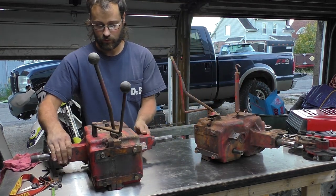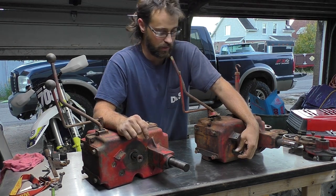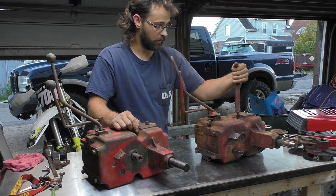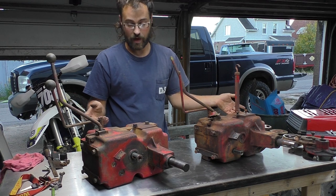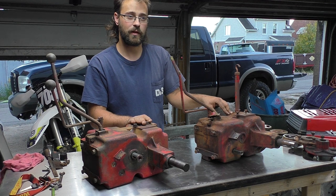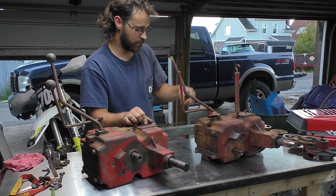The main difference between them is the brake shafts — this one is a lot larger and is keyed, and then the uni-drive has a double-D shaft that is smaller. Up here is a dipstick with a fill for the oil, and this one does not have it. I previously locked another one that I think is considered a 10-pinion — it has a limited slip differential in it, which is pretty neat. I'll post some pictures in the video.